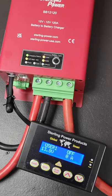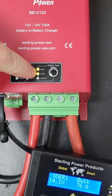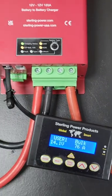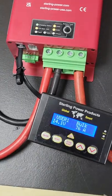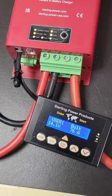It's just rebooted back up again. To tell from just looking at the unit that we're in a custom profile, these two LEDs light up. On the remote it says 'user defined one' — user 1 means it's the profile you've defined. It's now pegged to 76 amps because I've set it to 65% current limit.